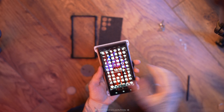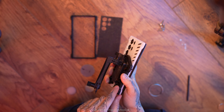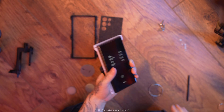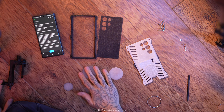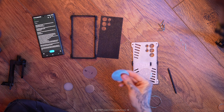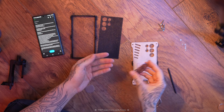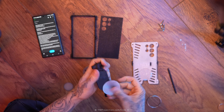That is still an issue I'm still having because you're obviously increasing the magnetic field quite a lot. But still, when using it without the mount it resolves one of the issues I've been having. A bit of background on how I came up with this method: I researched different methods on how to repel the magnetic field and it turns out it's steel. I need it to be stainless steel because I sometimes like to put my phone underwater, so I can't have the metal rusting. This steel needs to be ferromagnetic. 304 stainless steel wouldn't work because it doesn't attach to magnets due to the low iron content. So I ended up using 430 grade stainless steel, which is ferromagnetic — as you can see it attaches.